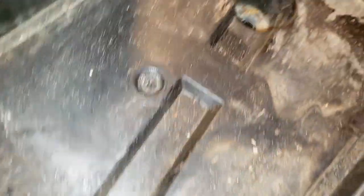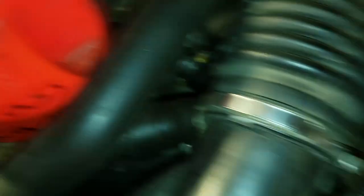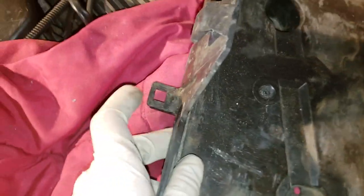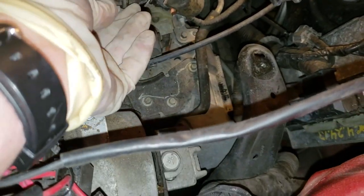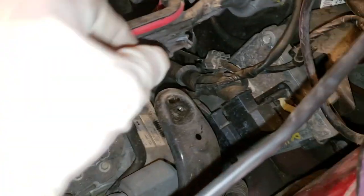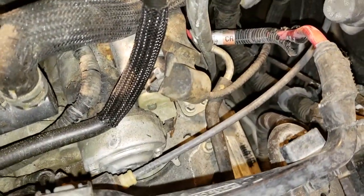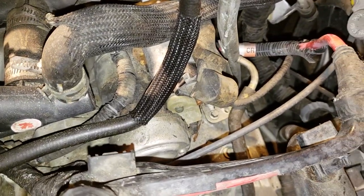The tray's out of here. Let me show you what I found. On the back side there's a tab — it looks like these slide in somehow. I pulled on it and it broke that piece off, but it shouldn't affect anything once it's back down in there — those wires are straight, so it's not going to make much of a difference. Coming right here you can see our wires. Now we can see a little bit better what we're working with as far as this starter goes. You've got your solenoid here on top, and then your starter motor right below that.